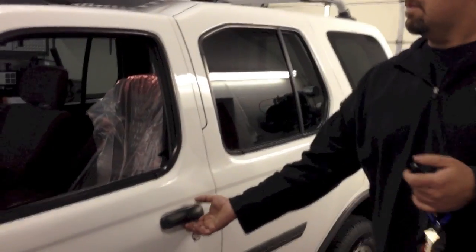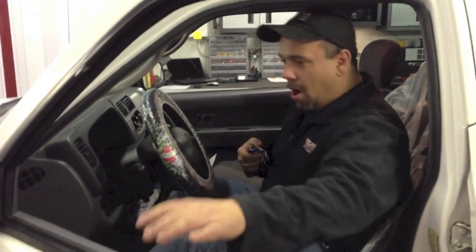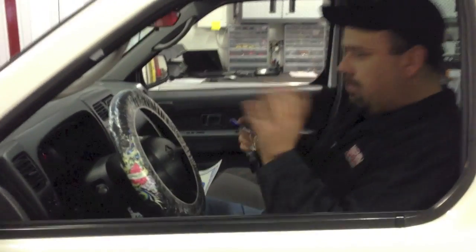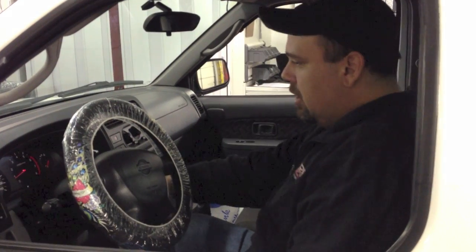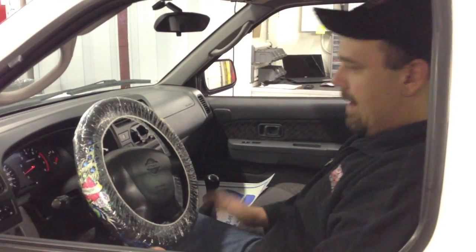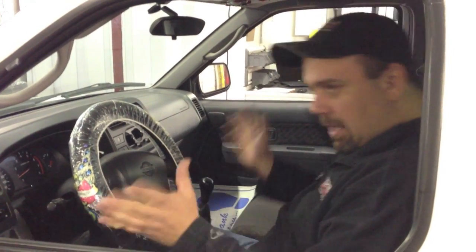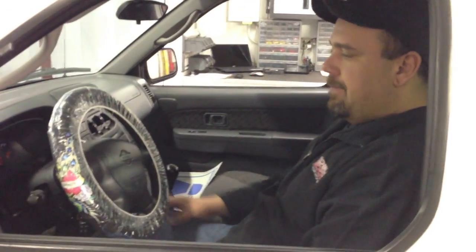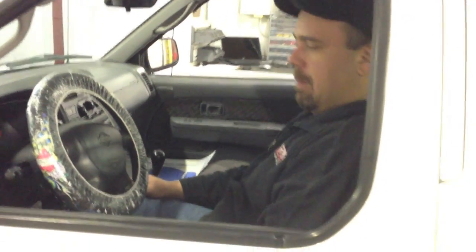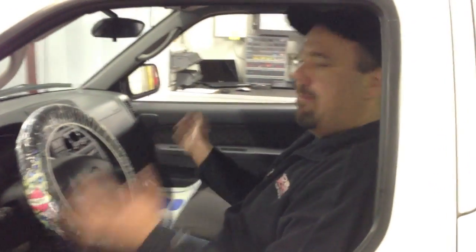The car is running now. When you want to get into the car to drive away — so you've done this from inside your house, the vehicle was left in reservation mode — you unlock the door, get in the vehicle. Do not step on the brake or the emergency brake yet. The first thing you do is take your key, put it back into the ignition, and turn it on. Now you can step on the brake, which kills the remote starter, and now the car is running on the key just like if you had started it normally. Now you can drive away — nothing's any different than it was before you had a remote starter.